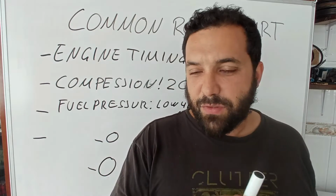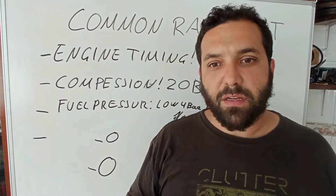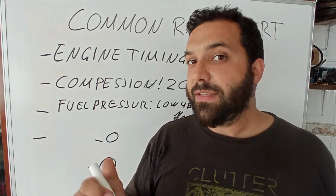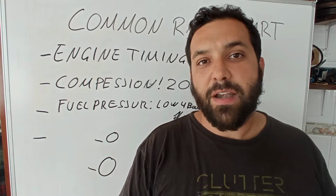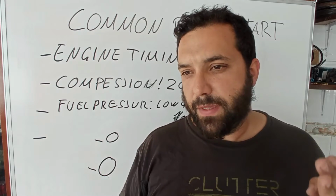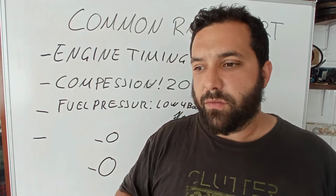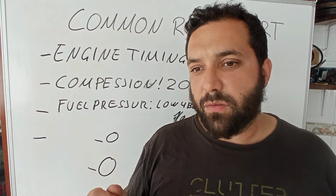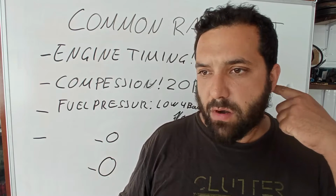That is what seems to be happening right now, because I have 0 readings on the RPM, and the car cranks and the fuel pressure is there. I already see that. But the injectors are not opening. But why are they not opening? That is very strange. Now you need to see more on the diagnosis machine. You need to see the authorization of the immobilizer, and you have to see more.